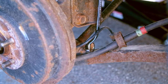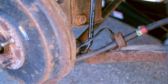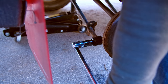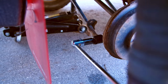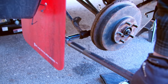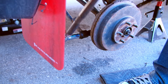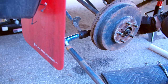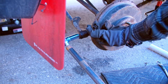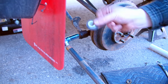We want to get a wrench on this back bolt here. You can undo the bracket on this brake hose, but I wasn't able to, so I was able to slip a wrench on the back of it, no problem. Unfortunately, my bolt was very stuck — it was even bending my breaker bar — but I finally got it with a ratchet and a pipe. After a little bit of elbow grease, we can get that nut off, and there is a washer that comes with it as well.